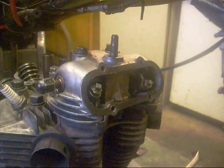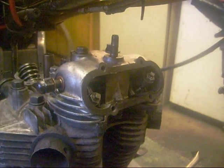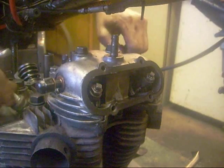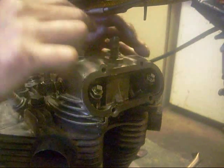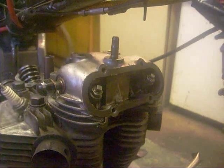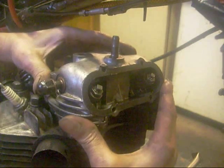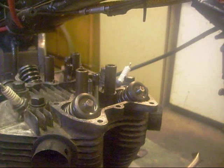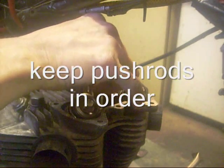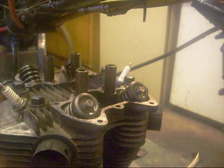Do the exhaust rocker. Roll your motor over, sparks out. Roll your motor over till both valves shut. Four across the top, three underneath. Careful with your push rods - I've stuck in, just heard it drop. Push rods out, and then the head bolts.